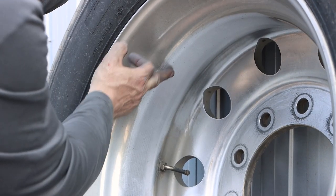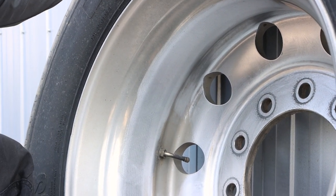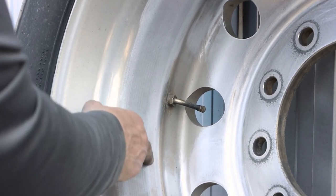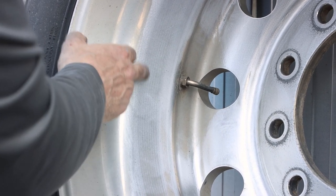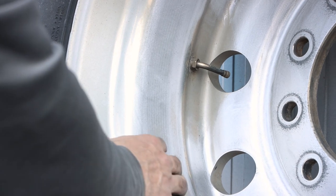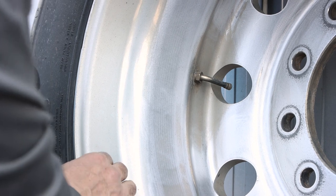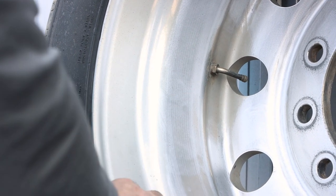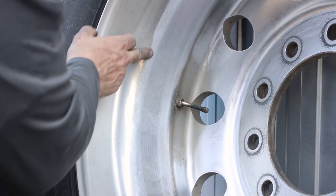This is the look I'm looking for — you can see there are still some machine lines in this rim, most likely it's never been sanded. You want to keep sanding until those lines are completely gone. There are rims way worse than this where the machine lines are more pronounced. These are very tiny, so they're coming out easily with 320. If they were harder to remove, I'd switch to 180 to get it done faster, but 320 is working well.